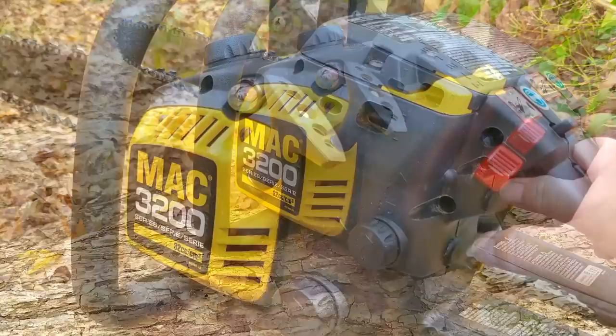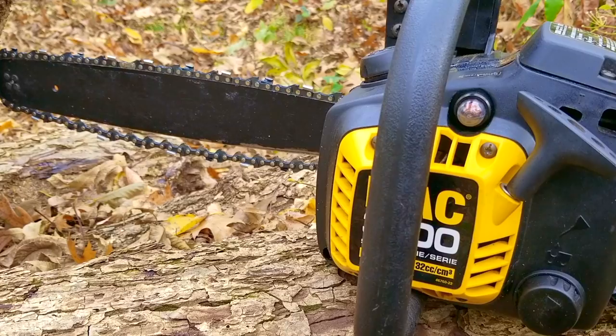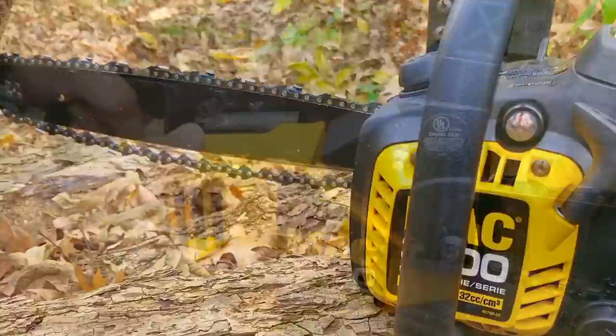So what just happened? I had to add some more fuel to the engine at idle so it could rev properly, and as a byproduct, it lowered the idle speed which then allowed the chain to stop moving. Also, the chain was way too loose.